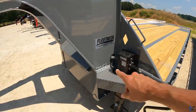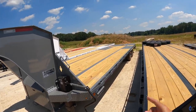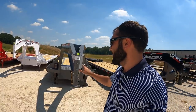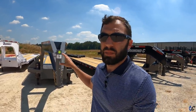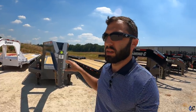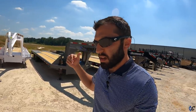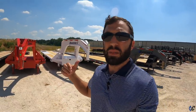This is an FMax 212 — a 32-foot trailer, with 27 feet of deck plus a five-foot dovetail, two-speed jacks, and max ramps. It's a beautiful trailer. With that weight, size, and rating combined with Hutch, I'd bet this is a construction-type trailer hauling a heavy excavator or something in that arena — they chose Hutch because they know it's going to stay hooked up and keep working hard. This same exact trailer is available with standard suspension, and I could see that on a farm hauling a tractor to the shop or hauling hay a few times a year. But when you get into heavier usage and higher mileage, you definitely want to check into Hutch suspension.